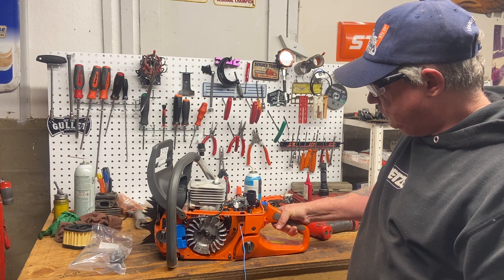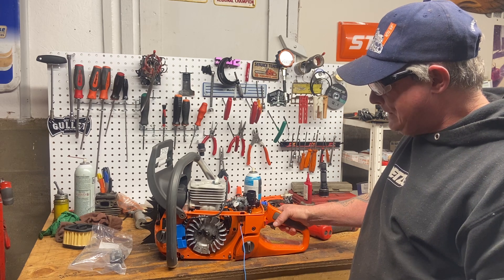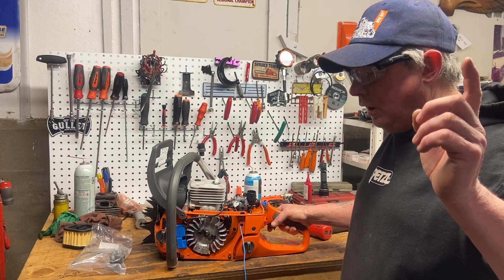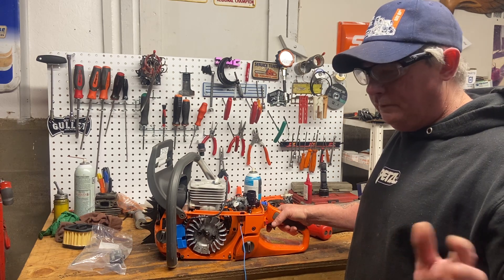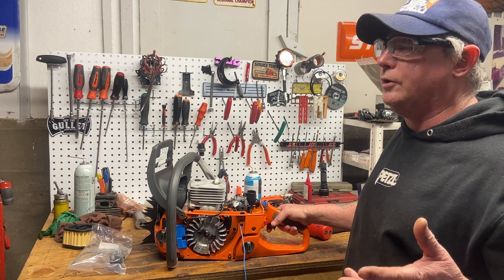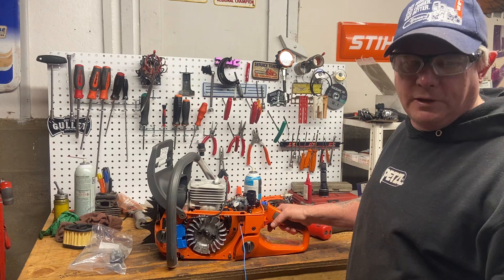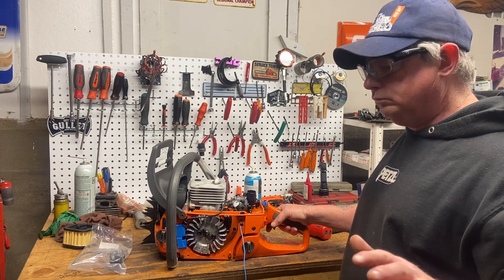If you are changing the ignition, make sure the carburetor is set right. Same as on a Stihl 461 — not the newer M-Tronic ones — but some guys put the 066, 046, or 440 coils on the 461 so they can rev them more. But the 461 already revs to about 14,700-14,800 after porting and modification — there's really no reason to go further. Guys who do that go through bearings in the bottom end. The factories aren't stupid — they set those parameters for a reason. We adjust them just a bit, but I like to keep things within reason so they last.